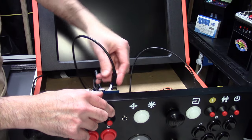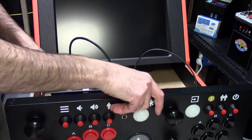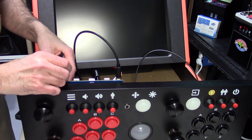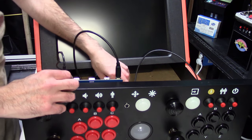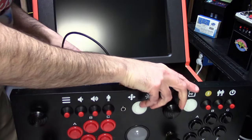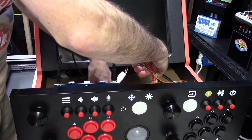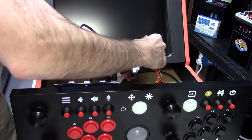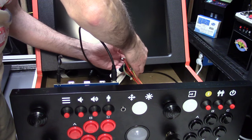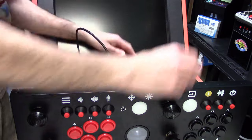There's my cable for the connector. That goes into our switcher board, so it's available to both units. And then I'm gonna plug in power. Next, we're gonna connect the GPIO pins. So once again, this is keyed, and the connector is so small, it is entirely possible to put it in backwards. So really look and see where the keys, the nubs are, as well as the holes. Take your time, and then push it in place. Make sure you're going down as straight as possible.